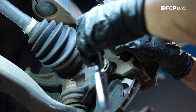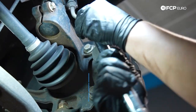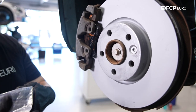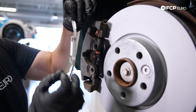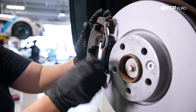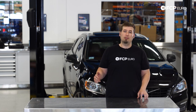Using your 7 millimeter Allen bit, go ahead and find the threads and tighten it down — you're going to have to probably wiggle the caliper around a little bit. Final torque on the slide pins is 28 newton meters. Replace the dust caps over the slide pins to make sure they'll stay nice and clean. For the new caliper spring — part number 30671546 for the 300 millimeter — just like when we took it off, make sure those little indents fit into these holes, get it seated, and then use the pivoting action to lock it into place. Lightly put the lugs on, and once they're on the ground they will take 84 pound-feet. That's how you change the front brakes on a P3 Volvo with a 300 millimeter rotor size. If you found this video helpful, let us know by leaving a like, hit the comment section below, and subscribe for more Volvo content.